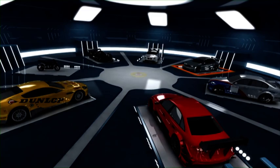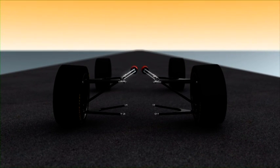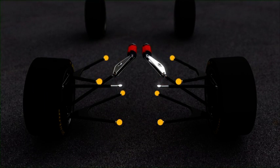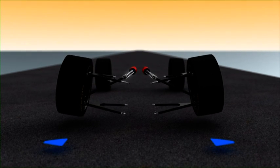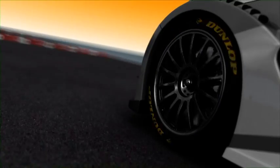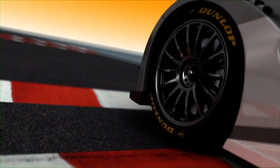The key is to utilize or spread the load as well as possible. For example, as in touring cars, they set a negative wheel camber. That means greater lateral guided force around corners — the pressure gets spread more evenly onto the tire's contact area. The aim: a high level of grip and steering control, for example through faster ground contact after riding the curb.